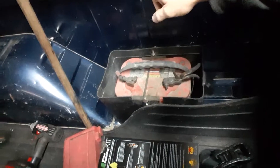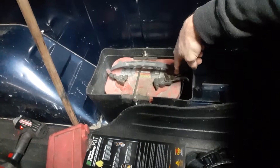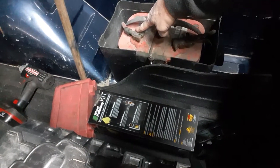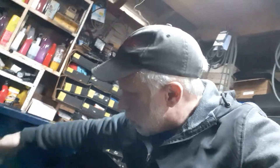Here it is — batteries are back here. The battery does not look fantastic; it is dirty and dusty. But hey, this truck gets driven every day. Here are the negative cables — one runs down and goes all the way to the front to the engine, the other one runs down and goes to the frame. Here's the positive, and the positive runs straight to the starter terminal. Very simple, but highly effective. And as you can see, yes, it is an Optima — many, many years old.